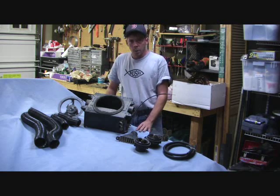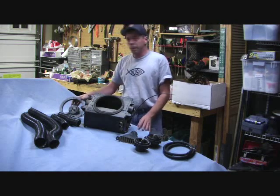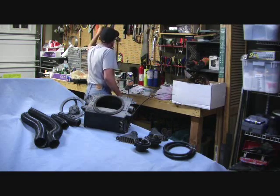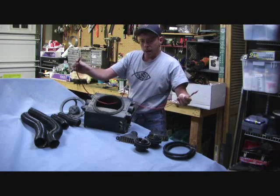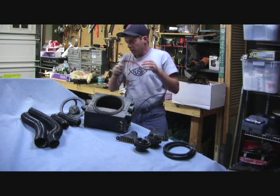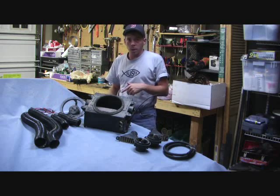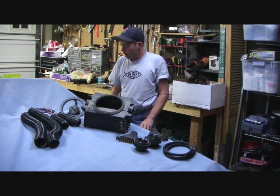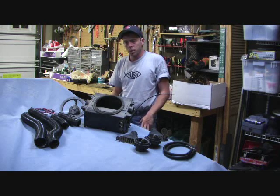Generally on the heating, the first thing to do is make sure your blower motor works. One of the tools I keep handy — something I patched together myself a number of years ago — is a double set of alligator clips with a fuse on the positive lead that allows me to test out just about any electrical component. The fuse ensures I don't accidentally burn out the unit based on amperage draw. We tested the fan motor and it works perfectly — the brushes are good.